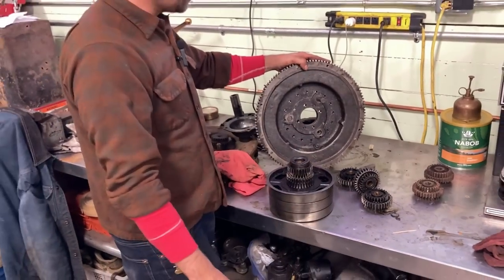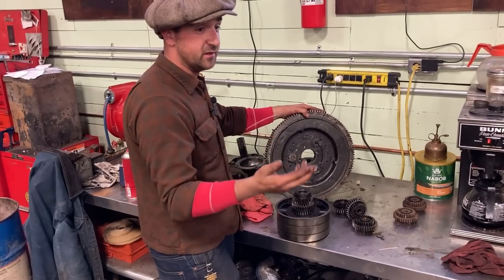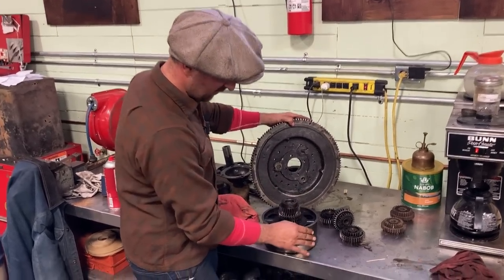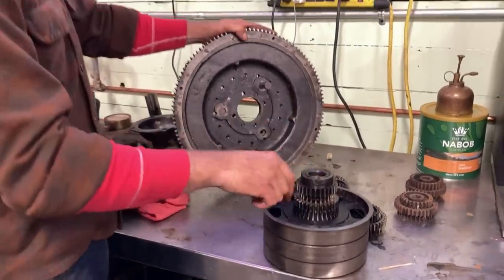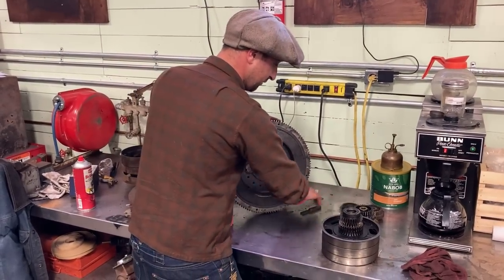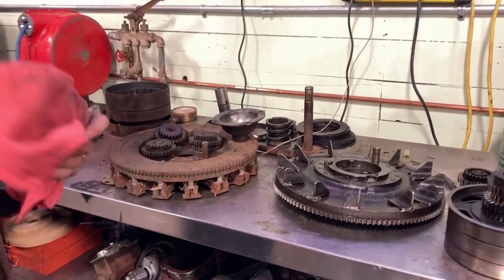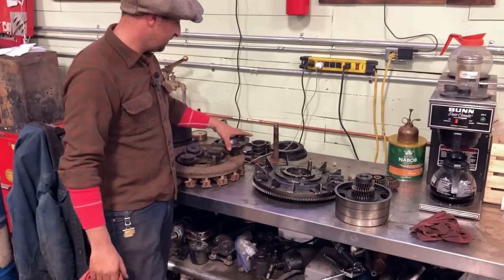The motor was still running but it was noisy. We managed to save it — it's a standard crankshaft engine, quite a beautiful engine. But the pan looked like a gold pan; you could reach your hand in and it was just soft brass from all the material. This is the drum that came out of there — it's no good. Because all this stuff is so worn, that's why we needed the parts transmission. We'll rebuild, rebush, redo everything, but with proper drums. You can buy new parts for this too, but good used original Ford parts are just as good, if not better.